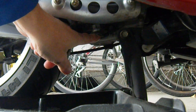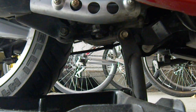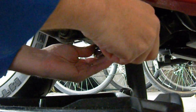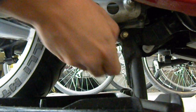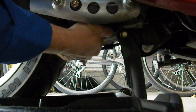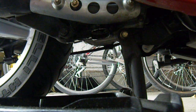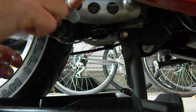On the other side of the engine is a little bolt that holds in the oil filter. It's just a screen that's reusable, so I'm going to take this off and get the screen out. It's a little bit tight so you've got to fiddle with it a bit. There is the plug and the spring — I just have to reach in with my finger and grab the filter itself. I don't see any particulates in it, so I'll give it a wipe with a paper towel and now it looks nice and clean.